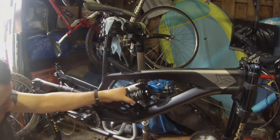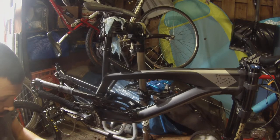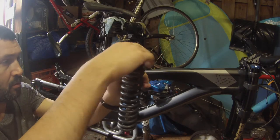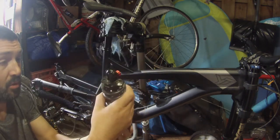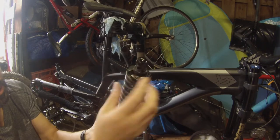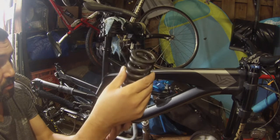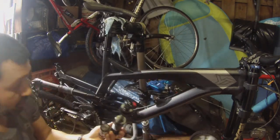Now we have the mounting hardware off. We're going to remove the spring — loosen up that preload just a little bit more, make sure the spring has plenty of wiggle room in there. You're going to turn the spring upside down and remove the retaining clip. That's simply just a slotted little clip. You push the bumper down a little bit, push that clip down, line it up, and slide it off, and you can remove your spring.